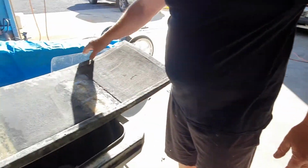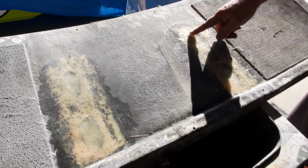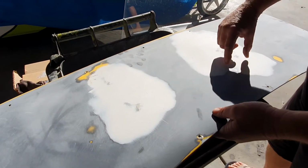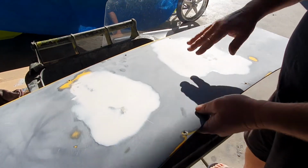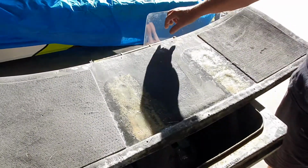So we did most of the building from behind and 1 coat on the outside, and that's a good one, job done. Same thing with the boot lid. We just laid the boot lid down on a bit of plywood, put 3 or 4 coats on the back to fill the holes, flipped it over, and once again 1 coat on the top, and then just blended in with some fine filler. That's pretty much all the holes to fill on the car done.